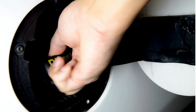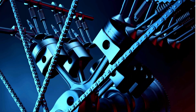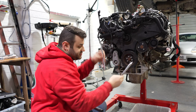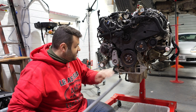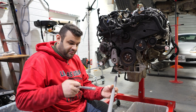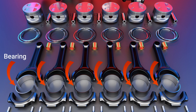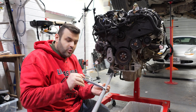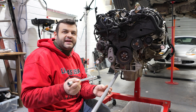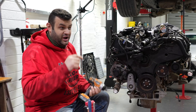When you put fuel in your car — in our case it's diesel — that fuel turns to energy. The diesel combusts, explodes, and it moves six pistons that go up and down. This movement rotates another shaft that connects from the front to the end of the engine, and I think this is where we have the problem. In between them there is something called a bearing — a metal piece, like a sacrificial piece. It wears out, and when it does you get knocking because there's a gap between them. That's what I think the problem is.